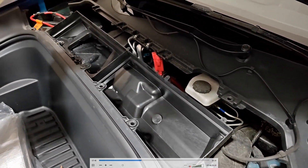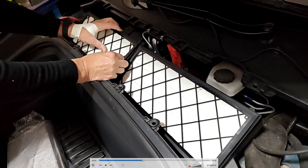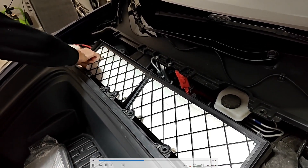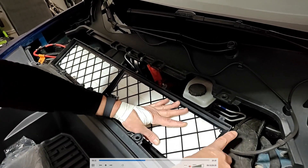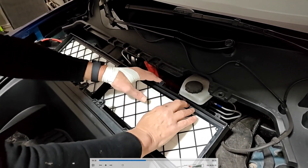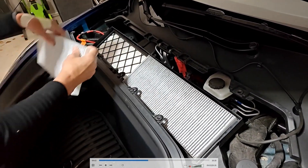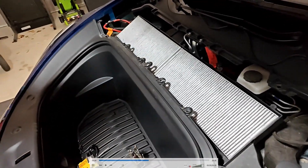Once we have the old filters out, we can put the new HEPA filters back in. Make sure you're putting them in the correct direction — you can just drop them into place. The gaskets around the outside will push against the sidewalls of the plastic piece, so push down on them to make sure you get a nice tight seal. The rubber seals around the edge will give a nice seal as you push it into place. Work your way around the perimeter to make sure it's secured all the way down. The top part of the HEPA filter can then just slide right into place on top of the other part.